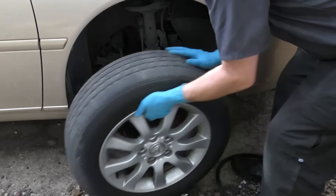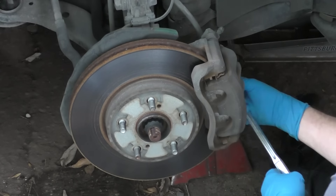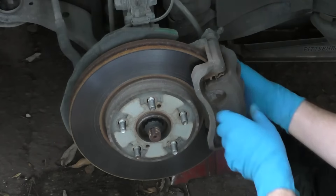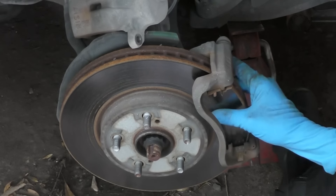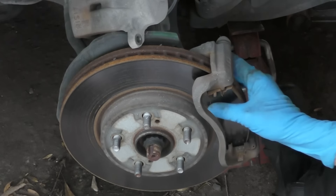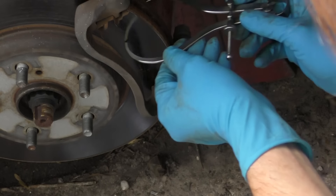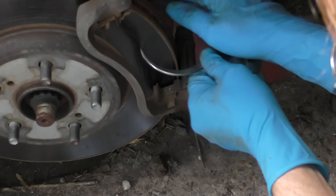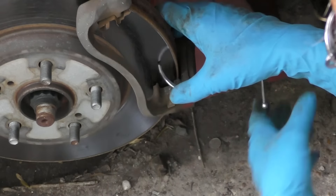We'll take the wheel off and check the brake rotors. Now to inspect the rotor, you have to measure various parts, and the easiest way is to take the brake caliper off. In this case we use a 14mm socket and unbolt it — the bottom bolt comes off, then the caliper slips right up and you can pull it to the side. Pull the two brake pads off and measure the rotor. You can feel if they're really warped, but you're better off using a measuring device. As a professional mechanic I have $500 sets of fancy micrometers, but you can go to a hardware store and get one of these outside calipers for 19 bucks — they work perfectly fine. You measure it at different parts, and if you turn it and find different widths, the rotor is warped, because it should be the same exact width the whole way around. You're better to measure than just guess.